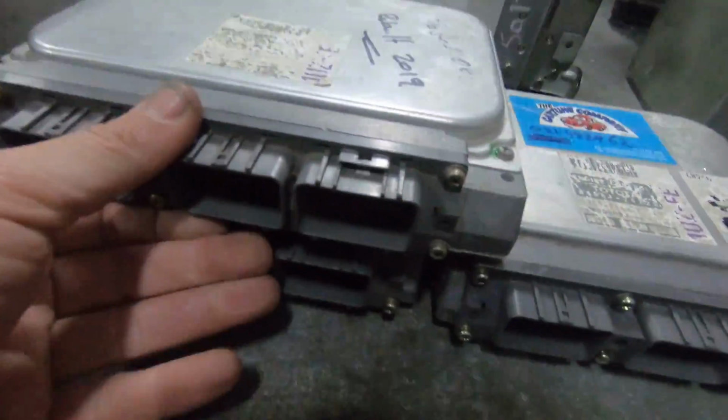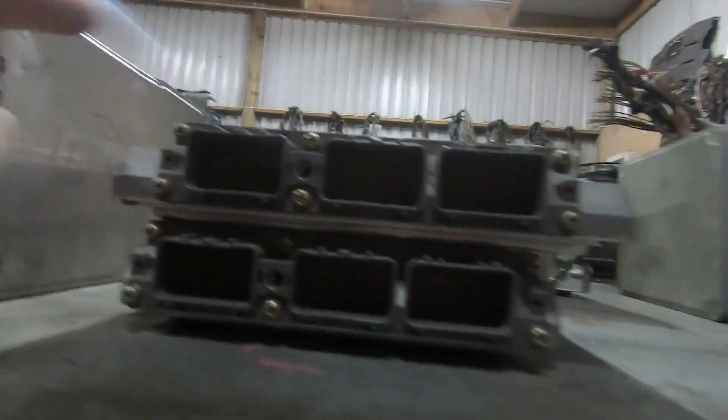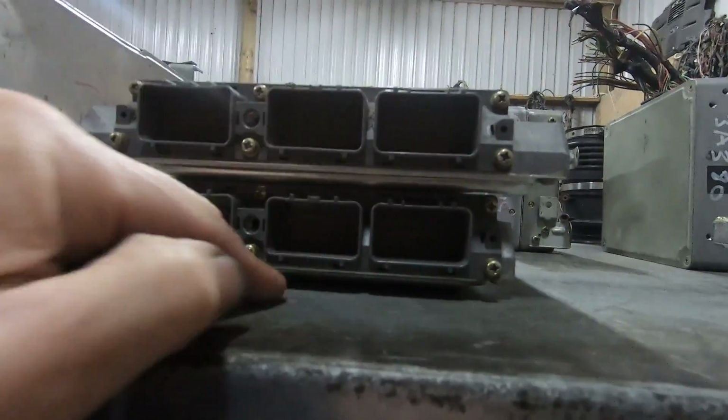Compared to the Crown, you'll see it hangs out. Let's turn that over there. So there's the Crown ECU above a Soarer ECU. So much wider in the body. Similar pinouts. Now I say similar pinouts because early Soarers that we see had a single oxygen sensor, and the Crown had a 4-wire oxygen sensor. So there's a difference. They changed transmission. They put a temp sensor in the transmission. And they did that between the 2 UCF10 ECUs as well.